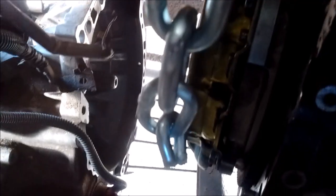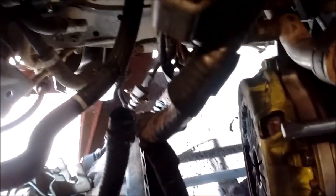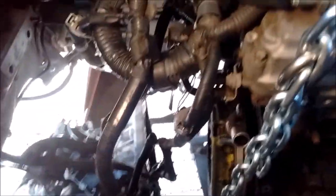To put it back on, what we would do is lower everything down, match up the two holes in the transmission to these rails, match up the holes in the bell housing to the rails, push it on slightly, and then let those two rails take the weight of the transmission while we wiggle the input shaft into the center of the flywheel. Maybe I'll cover that in a video a little bit later.